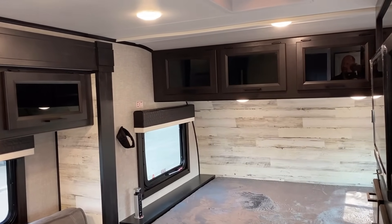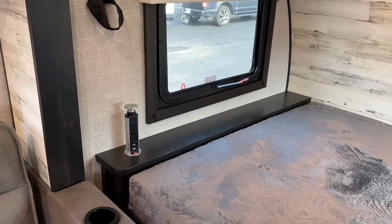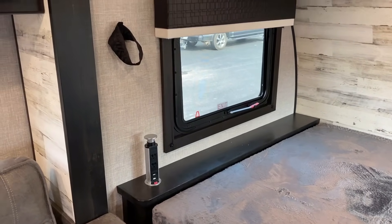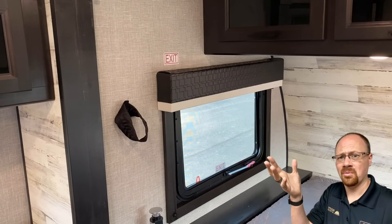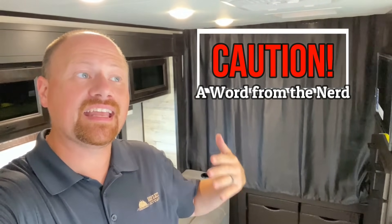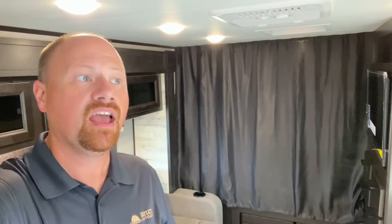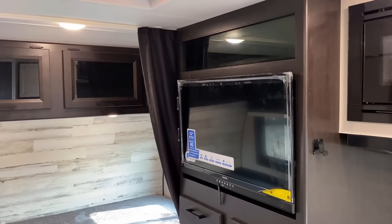Dealers who live not close to Jayco need RVs that can be doubled and tripled up on flatbeds, and if you go over 20 feet that really becomes problematic. Up on the headboard — it's nice that you get both a headboard and the full length bed, so somebody like me is not kicking the wall all night. You've got that pop-up power tower to keep phones charged. You might notice that little fabric loop hanging in no man's land — the camper has a full privacy curtain — but when it loops against the wall on that side, the curtain can actually get caught in the slide out. I think that's an oversight. You should tuck it behind the entertainment center, not use the factory-provided loop, because it can get gummed up in that slide. Best case, you'll have a chewed-up curtain; worst case, you'll need slide work.